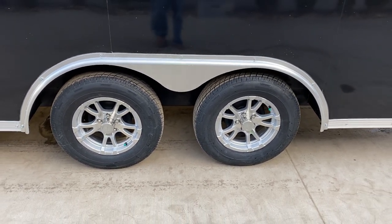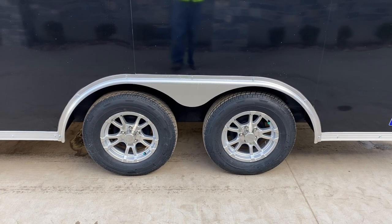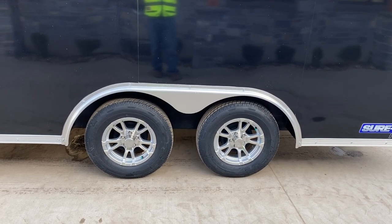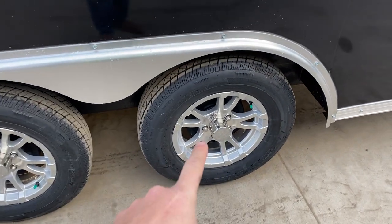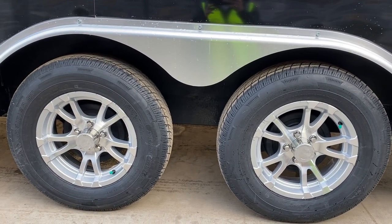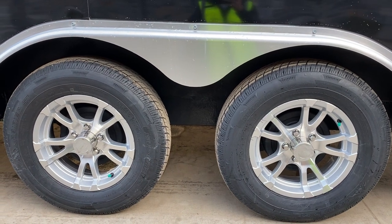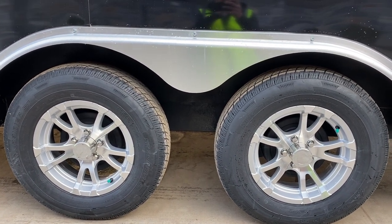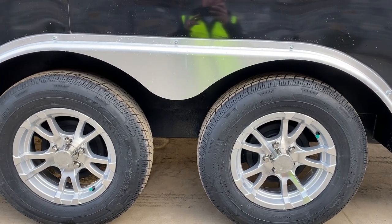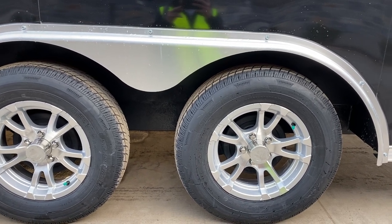Aluminum wheels are standard equipment. This also has brakes on both axles with the newer style forward-adjusting — or what some will call self-adjust or never-adjust — brakes. They self-adjust throughout the life of the pad, with very little if any maintenance required. It also has the newer style easy-lube hubs. Behind the caps there is a greaser, so you can do your own bearing maintenance with basic hand tools. This unit also has torsion suspension — you can tell because there's no equalizer in the center. Leaf spring is like what's on a dually; torsion is more like what's on a Cadillac. Very smooth ride, sometimes called Torflex or rubber ride — normally what's on your aluminum trailers and higher-end stuff.